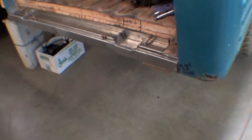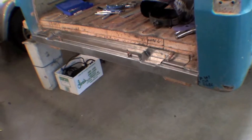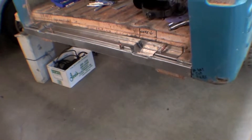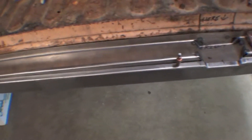Well, here we are, we're about three quarters done with our rear gate mounting, rear body panel braces, stanchions, and all the other things that make up the rear piece of the body. As you can see, we did our cutouts this morning and made up this panel, and we've got them tack welded in. Those will all be finished welded in, metal finished like the rest of it.